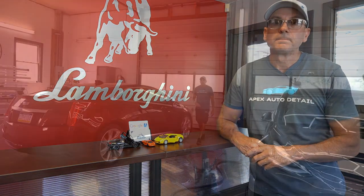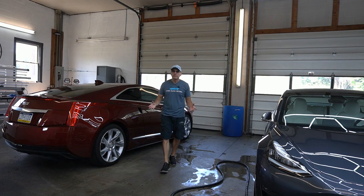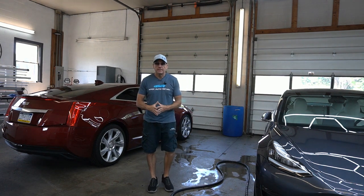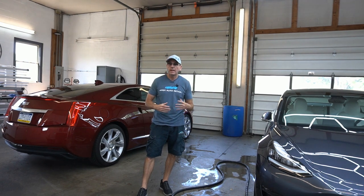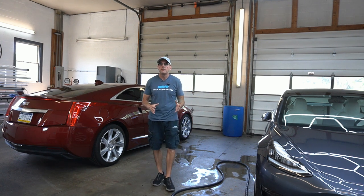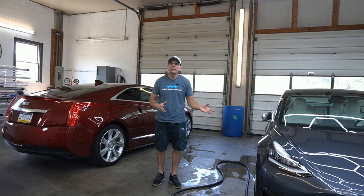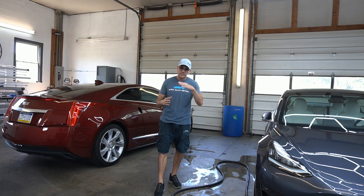Okay, to sum up the video, clear coat is a form of plastic. Polyurethane, for the most part, polyurethane and acrylic. And there are different shapes and forms and different types of clear, as I mentioned. And we are transitioning from an organic solvent-based to water-based. It's going to be a different beast. And as they continue to transfer from one to the other, it's only going to get thinner and softer.